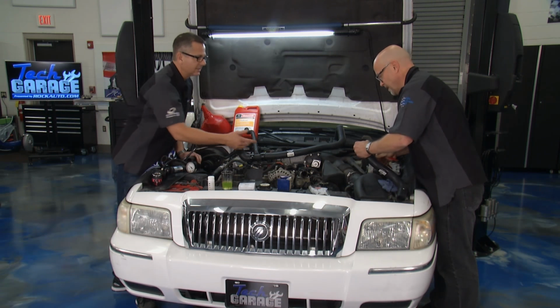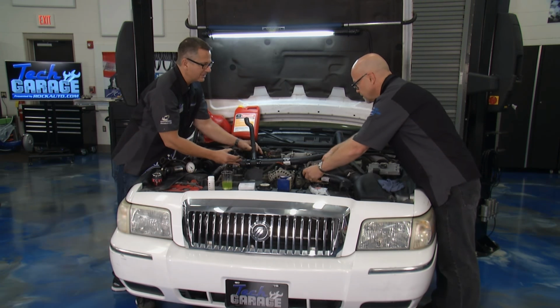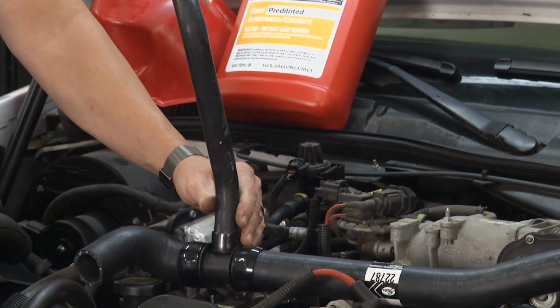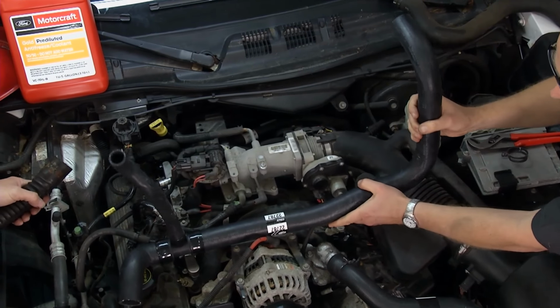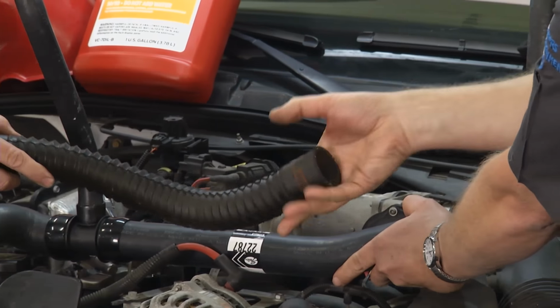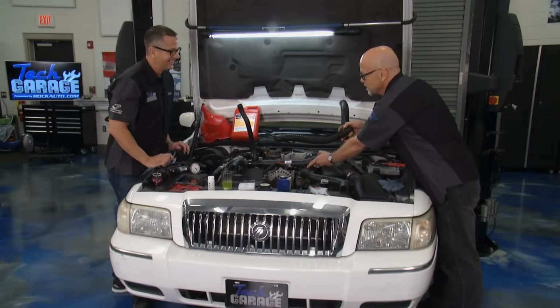Tom, we'll get that put on there in a second. Why don't you just let it sit there. Talk about this hose for a minute because this is actually crazy. Yeah, you see that a lot these days. The super complex radiator hoses, you'll even see the radiator cap on a fitting in the middle of the hose. Yeah. And this is something you want to get the original equipment style system. You don't want to use something like this, a universal one size fits all. No, not on this fitting. You'll create a plumbing nightmare.